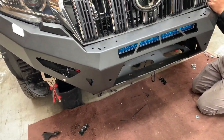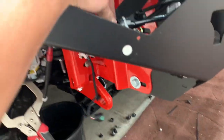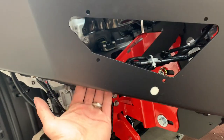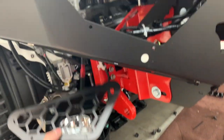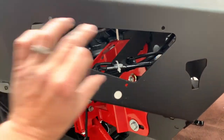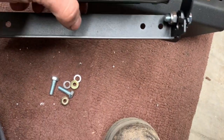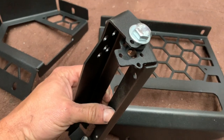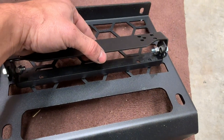Time to put the fog lights in. Shift that out of the way, get the fog lights in from behind — grab the whole thing, flip it in from behind. Put your four bolts in. The number plate flip goes together with a little plastic washer between, with two points in and out, then put the number plate flip on like that.